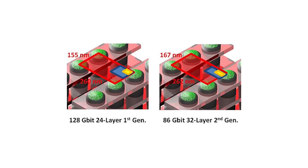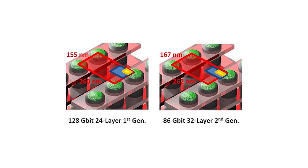So what did Samsung do with the 850 Pro that's different? They're kind of in the middle — it's an 86 gigabit die. It's not an even increment of anything. It's the 32-layer V-NAND. The 24-layer V-NAND that came out previously was 128 gigabit and was an enterprise part. But for some reason they threw that out and said 86. You would kind of think, just based on the capacity per die, this might be in the middle as far as how write speeds taper off at smaller capacities. Totally not the case — like, at all.